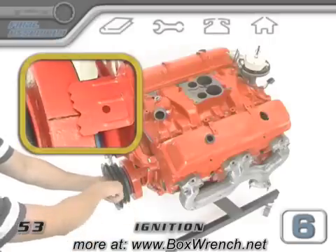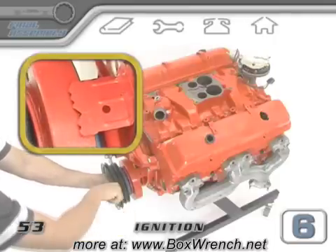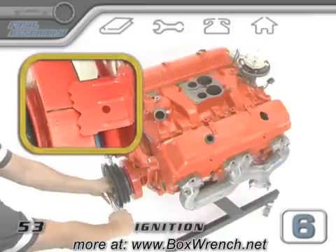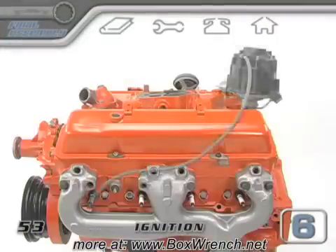When you feel air rushing past your thumb or hear it through the whistle, take a look at the timing mark on the balancer. Move the crank very slowly and when the timing marks on the balancer and timing cover line up and read 10 degrees — or whatever your initial timing is supposed to be — stop turning. Right now, your engine is paused at the exact moment in time where it's going to fire a spark from the distributor to the number one spark plug.